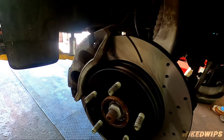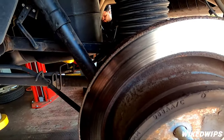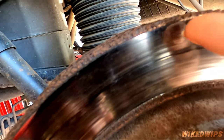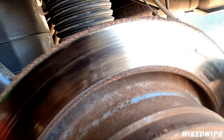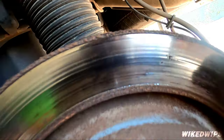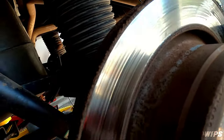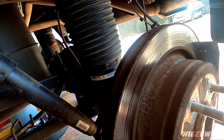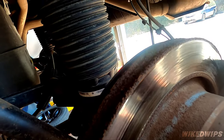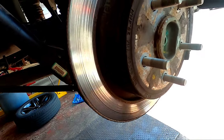The fronts are finished, now it's time for the rear. These rotors are seriously messed up — there's a lip right here, look at that. It's so coincidental that I was actually getting a vibration, and now I can see why. On these trucks especially with a light cab in the back, a vibration from the rear can travel up to the front and you might think it's the front.